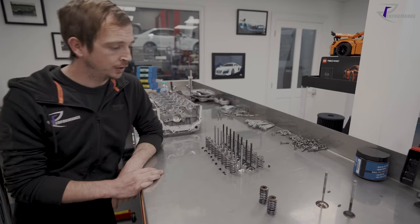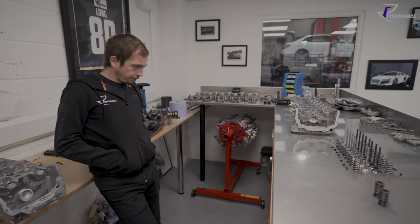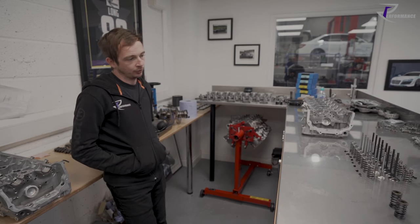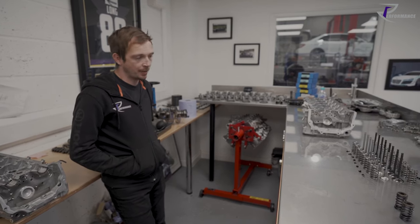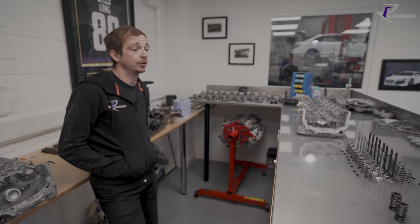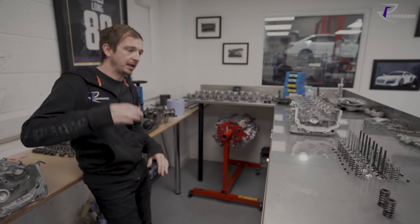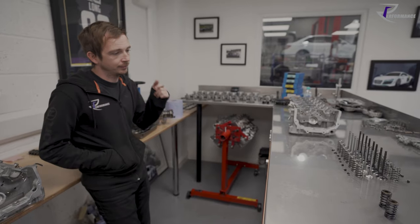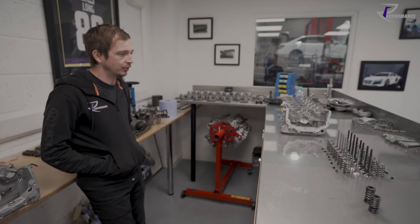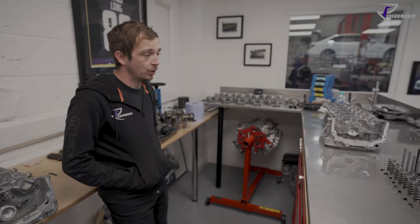Being realistic, you could. You drop valve heads, Christ. 10 years ago doing Super Sport, we were revving R6s to what, 16,000 RPM. One of those little guys drops a valve head, you take the engine out of the bike and put it in a bin. It had a valve life. We were running them close, at high RPM, and they got battered. And that's the balance: you can have it cheap, fast or reliable. Pick any two. So we do fast and reliable, but they're good quality parts and they work well.